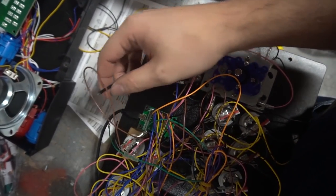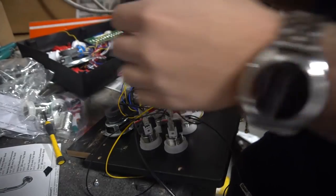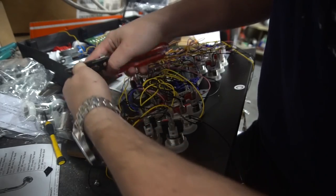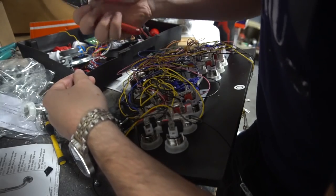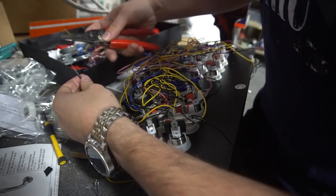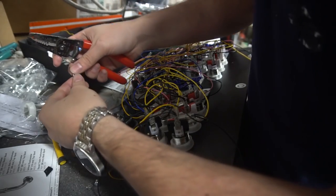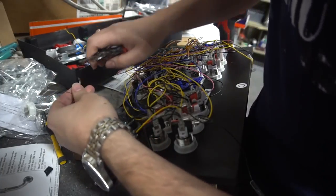Now you could take your splicing tool and splice your wires. Well, we are doing the speaker mount, might as well do the splicing. You could solder this. It's very important to be careful when you pull this. You don't want to pull your wiring out of the soldering from the speaker. So again, I'm going to take out this black kind of housing. I'm keeping a lot of control on my left to make sure I don't pull the wire out. I'm going to separate these. Give this a pull. I got one out.